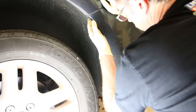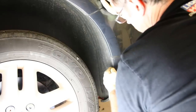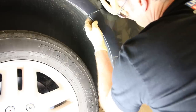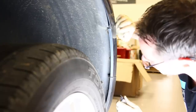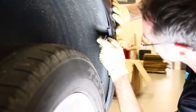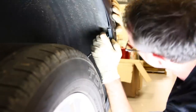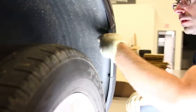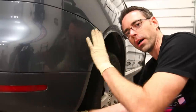Now we're going to take off the five Torx screws that run in here — one, two, three, four, and five. The last one is right up here at the seam of the bumper cover. You're not going to be able to see much, but this is the upper Torx screw we're getting, and then we go down and remove each of the lower ones. Now we're going to do the same thing — loosen the same screws along the fender liner on the opposite side.